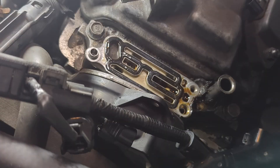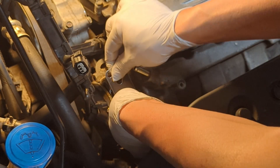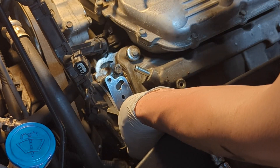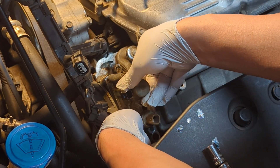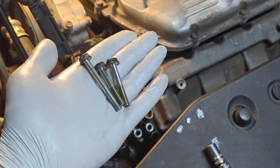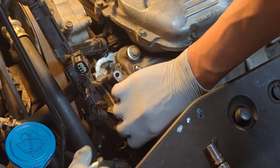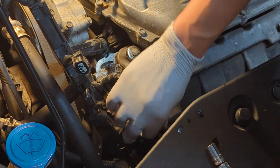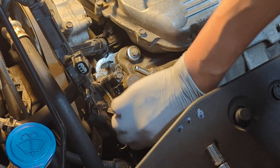If this is your case, try another gasket and make sure it's 100% fit, then follow the rest of my procedure because the only problem in that attempt was the gasket itself. We have a pin here to hold this in place, so let's put it back. I'll let the pin go in first, and then the other one. Three bolts — the long one at the top, and then the other two at the bottom. Thread everything first because the last thing you want is to cross-thread. These bolts do not hold a lot of torque.